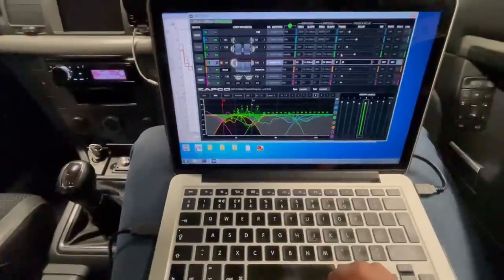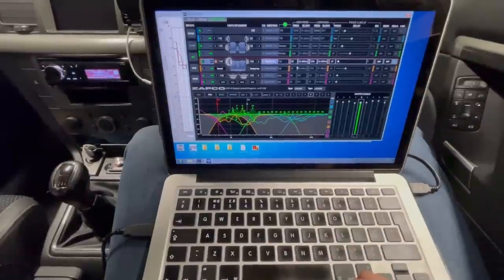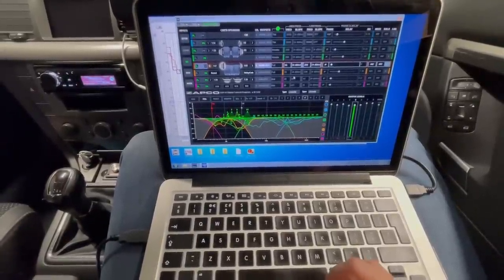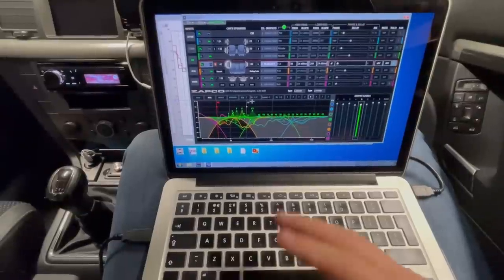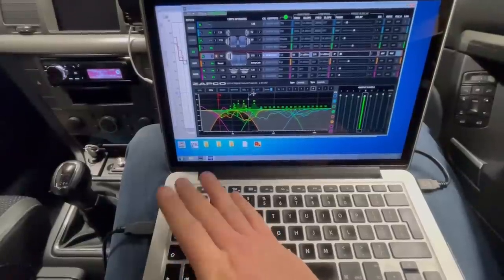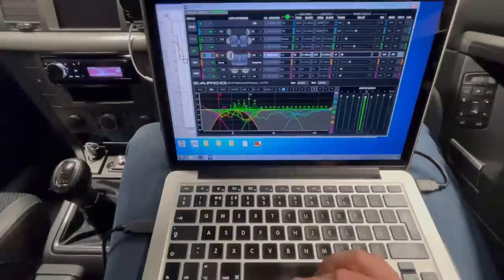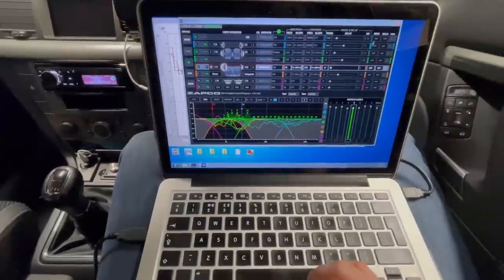Tuning with this app called DSP Z8 Mark II. The Helix DSP3 would do an equally good job sound-wise - they both sound great. I still find Zapco a bit more musical. It's easy to work with: fully parametric, 30 or 31 bands. Type in which band, hit tab, it jumps to the frequency, tab, level, tab, Q - max band. Everything is on one page, time alignment - that easy.